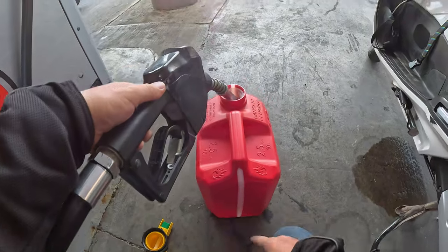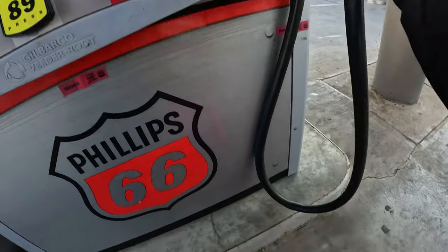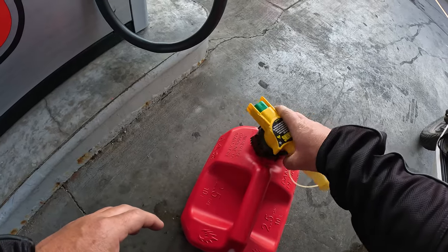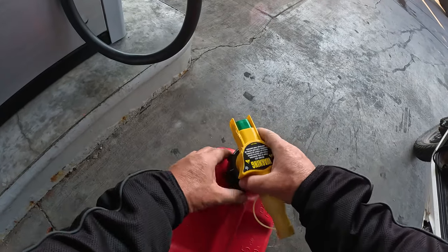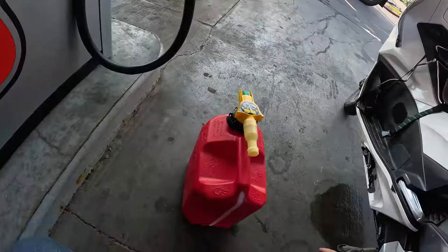Look at that, $9.15, 2.5 gallons. And I'm right there at the line. So we're going to see how this new OEM variator does in comparison to the Dr.Pulley that I'd been running. And it should probably drop a little bit because the Dr.Pulley gives you a taller ramp profile in the front, which means lower engine RPM per given wheel speed.